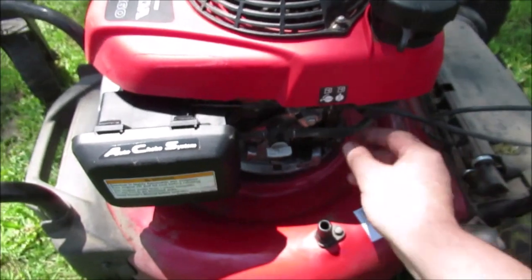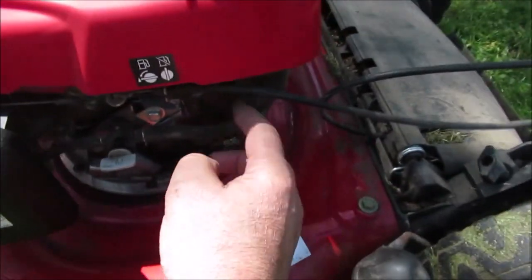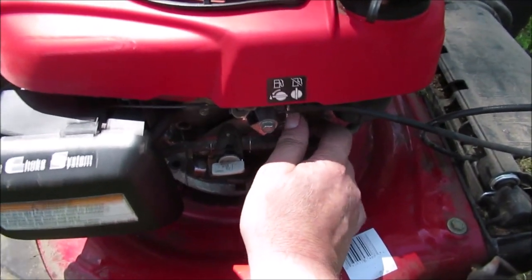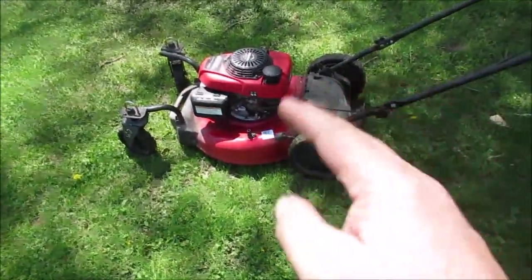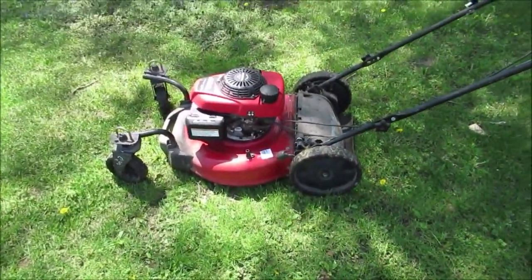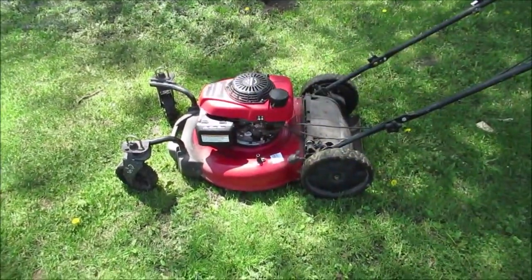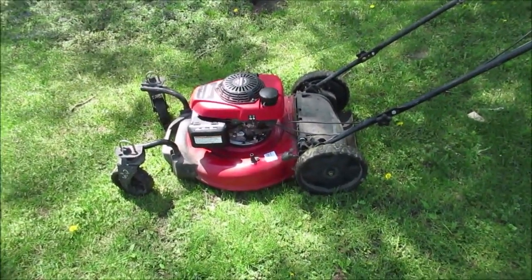It's so cold — it got started about a minute ago. Don't play around with these governors. You don't want to override the governor — the thing in the middle, if you push that trying to force it back, you could break something. See how crappy it was running? It'll start warming up. That funky spring thing up there is part of the automatic choke — it was a little fast when I first started it. Thanks for watching.